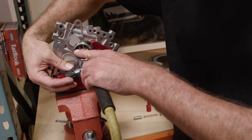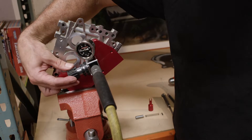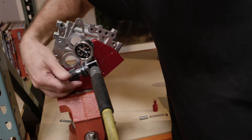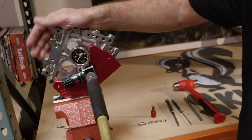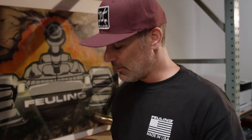We like to see the valve seated and sealed to 30 to 35 psi at the lowest, with a full pop-off around 55 to 60 psi. This cam plate is showing a full pop-off around 40 psi, so the next step is to show the process to seat and seal the relief valve.